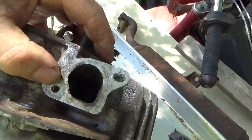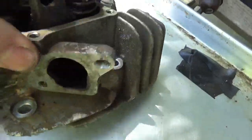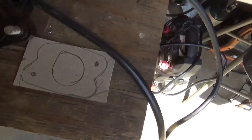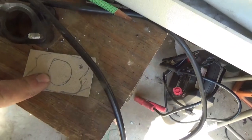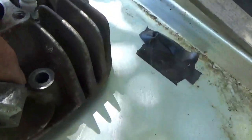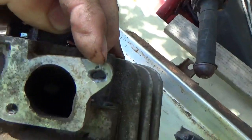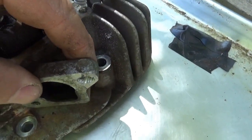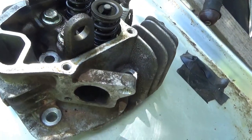Obviously, I've got one tapped hole left; this one is drilled out. So what I'm going to do is make a gasket for this — I already traced it out right there. I'm going to make this gasket, then put some Permatex on the back end of it, glue this to the engine block, oil the front, put this on, and put a backer bolt right through the back of this. I'll make sure whatever length I use is just only as long as it needs to be, then put a backer nut on it. Doing it this way gives me the best chance of success.